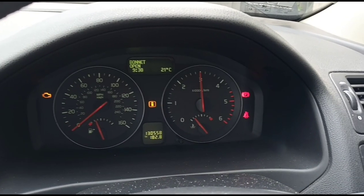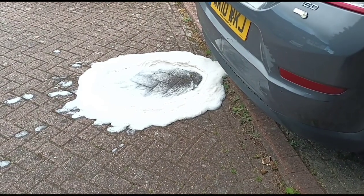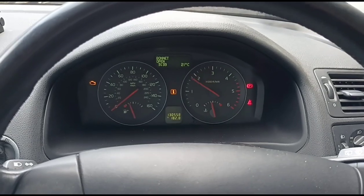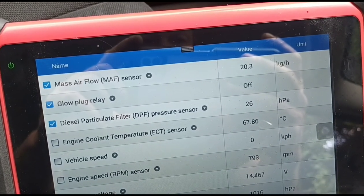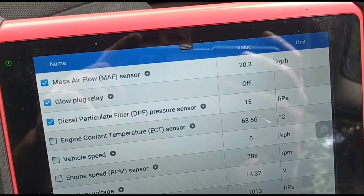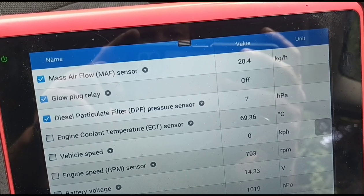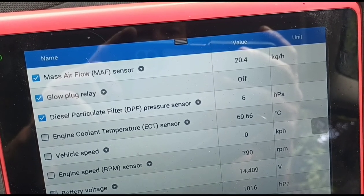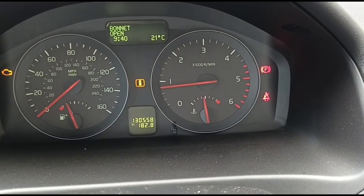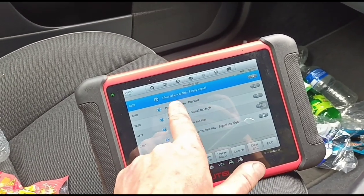We can't get full acceleration of course - it's limited to 3000 RPM when stationary. The fluid left a little patch on the floor that'll dry up. Releasing the accelerator now to see what we have on idle - it'll be dropping down slowly. It's holding at about 6-7 now. The vehicle isn't fully warmed up yet, almost at the thermostat center. I'm going to switch it off and clear the codes to see if it will allow more acceleration. Glow plug control relay faulty signal is still showing.